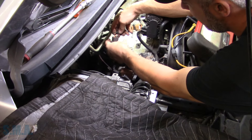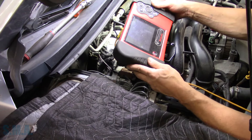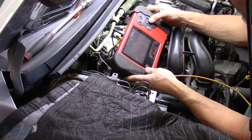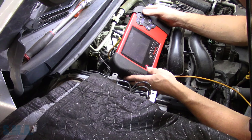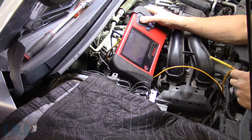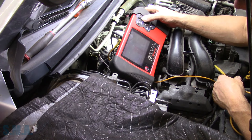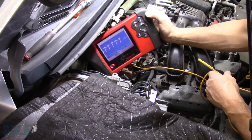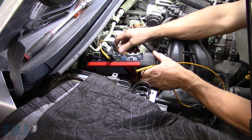We are after the gray wire — so we've got a gray and a black right there. We'll confirm that we're on the right stuff by testing a couple of the other solenoids first. We're going to come down to the digital meter, go to ohms, and set our scale. We don't want it on auto because we don't want to wait — so we'll set that on 40 ohms.